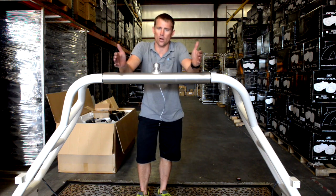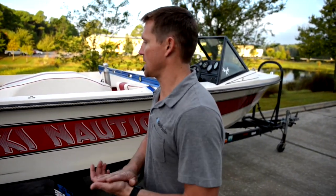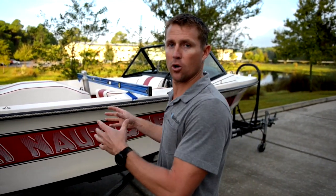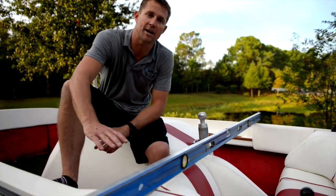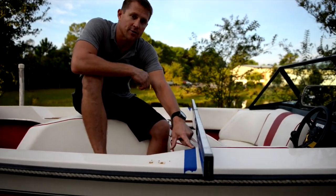We're going to find out what beam widths we'll need on the tower. Our buddy Brad decided he had to have the new aviator tower mounted to his classic 1988 Ski Nautique 2001. Now that the tower is built, we're going to measure the boat, find the proper placement of the tower feet, and get that situated. Every boat is different. On this boat we took distances from the windshield back and decided to place the tower just behind the driver, finding a nice style line in the gel coat as our reference.